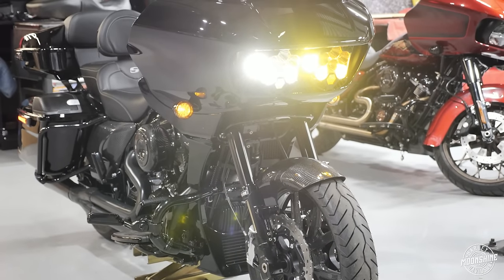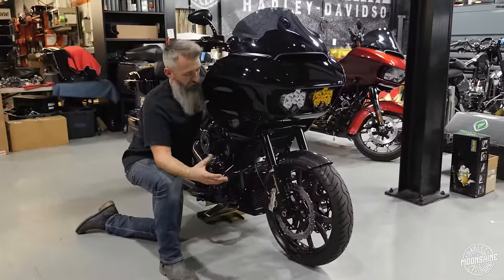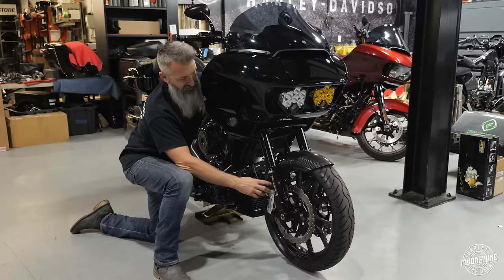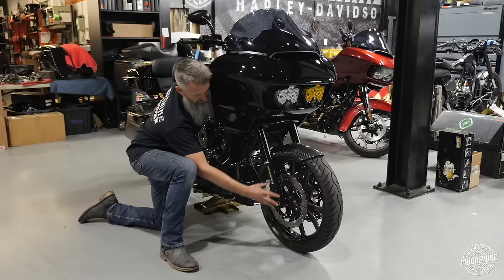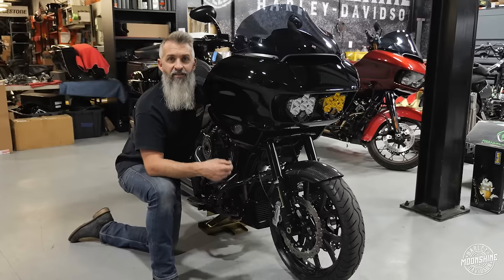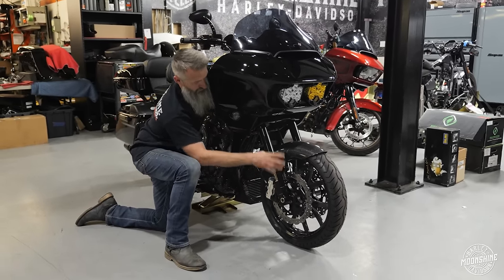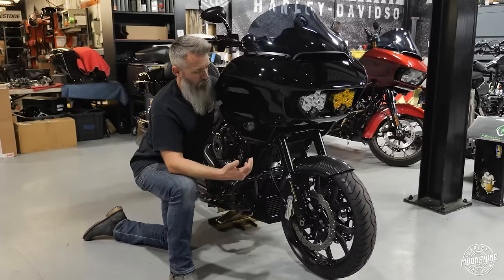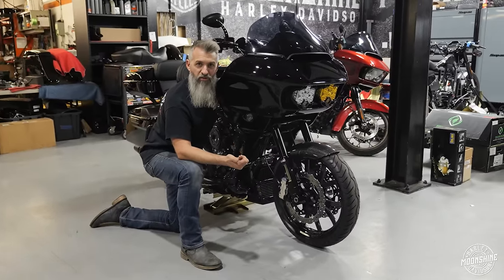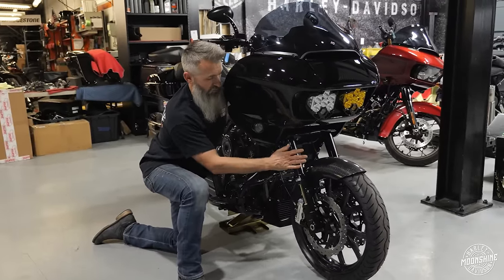The reason why the inverted fork is so nice is you are removing all the weight from the standard fork, which has the fluid on the bottom — and fluid's heavy. Think of a gallon of milk. We're taking the weight of the fluid and moving it to the top of the fork so the fluid isn't moving anymore. Just the slider is moving. The lighter you can make the parts moving up and down in the suspension, the more performance you gain and the quicker the suspension can react. Sport bikes have been running inverted forks for 20-plus years. The Ohlins is the top-of-the-line suspension; Harley-Davidson is now incorporating them on their 2023 CVOs. This Krause Moto setup is levels ahead of that factory fork, which is why we go to these on our bigger builds.